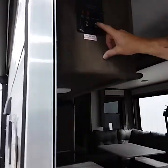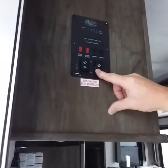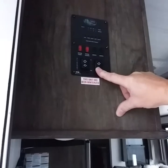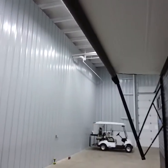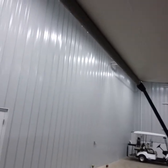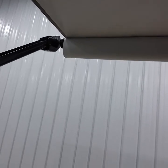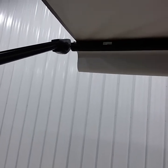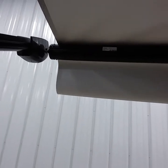Inside you have a button that says In or Out — we're going to run the awning out. As you can see it's moving outward — it's all done by power. As it runs out the valance will drop down. You'll see a sticker in the far left corner — take your finger off the button at that point so it doesn't roll inside out backwards. That is the fully extended position.